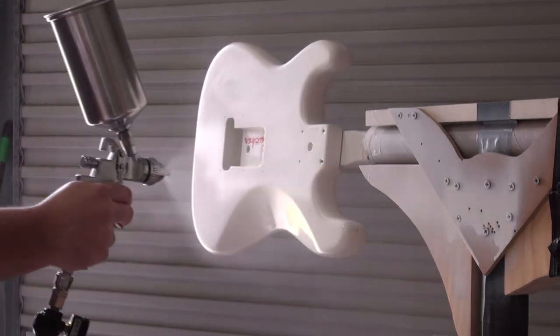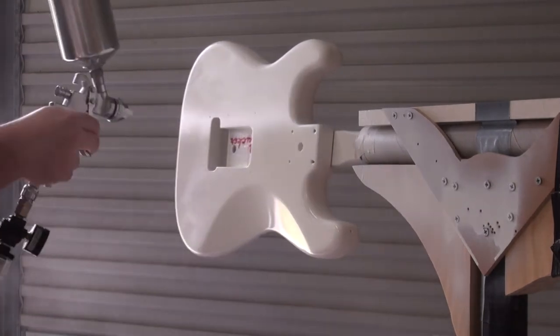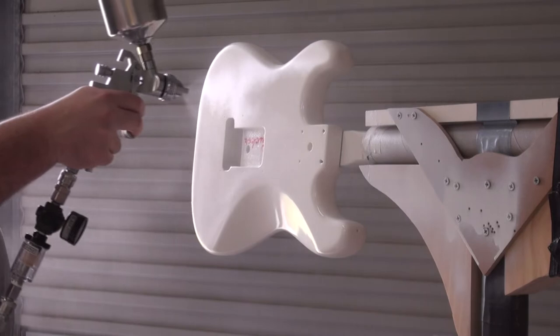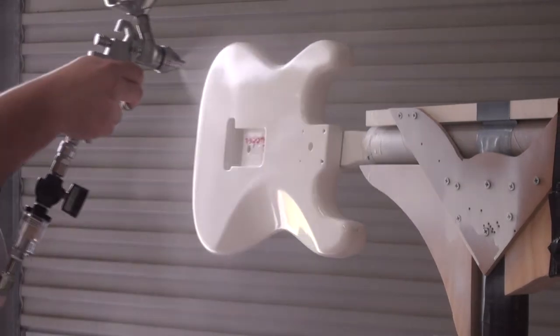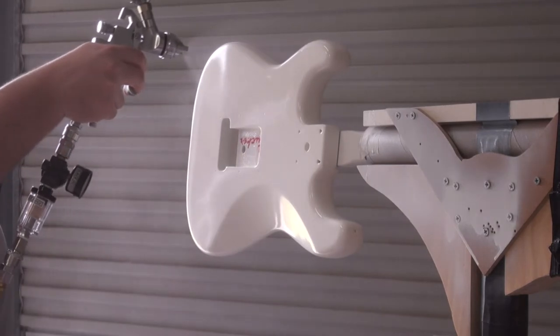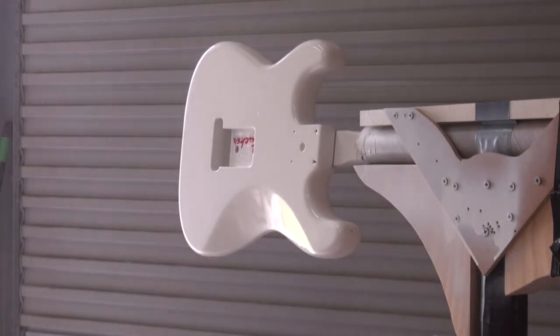It was uneven shades across the different areas depending on how thick I laid the clear in different areas, combined with how I would have wet sanded some areas more than others, leaving thicknesses uneven. So all over the body there are slightly different transitions of lighter off-white to creamy vanilla or a bone colour. I quite like the way it turned out in the end.